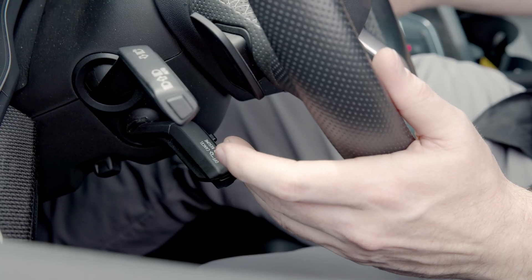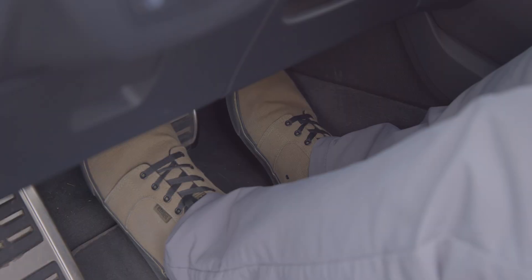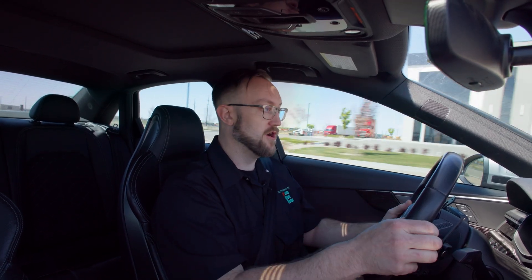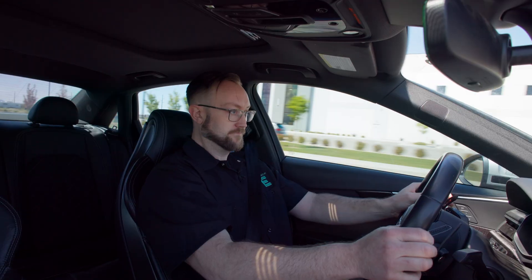When you're at the speed and RPM you want, give it a little bit of gas above 5% throttle. Hold down the cruise control stalk and then full throttle — this will build up boost, and when you're ready, let off for a rolling launch. For best results, you'll want to be going between 40 to 60 miles an hour and above 3500 RPM. If you are at too low a speed or too low an RPM, the engine will struggle to make boost and rolling anti-lag will lug it and you will not get that rolling launch.